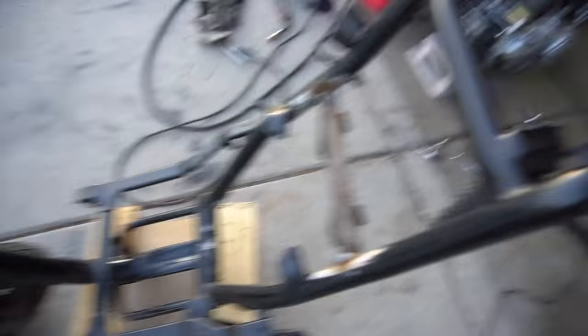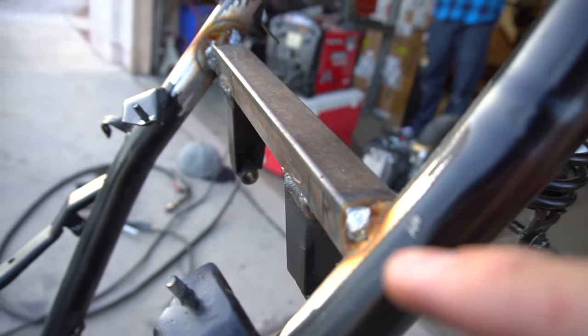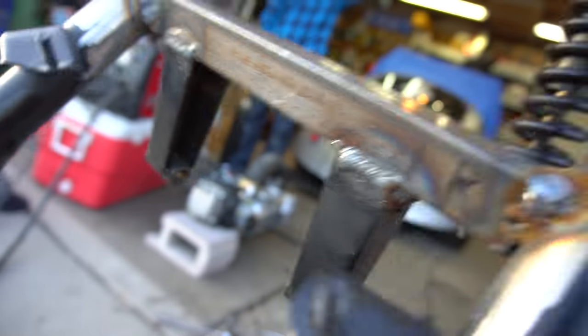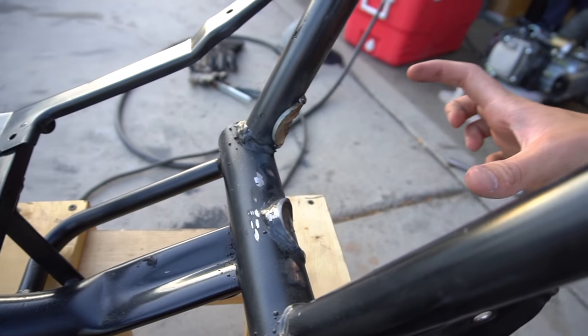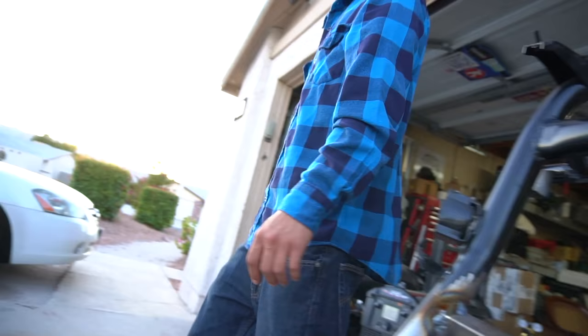For those who didn't get the full idea of how we made the motor mount in yesterday's video: we literally took square tubing, cut off the old mounts that usually come out of here, welded them to new tubing, and then just leveled it all out.